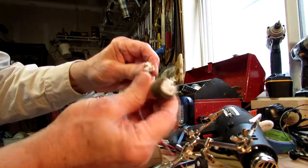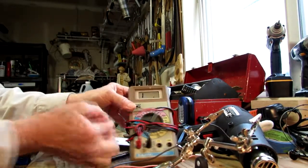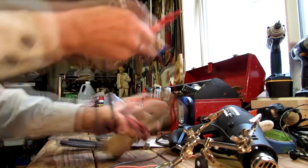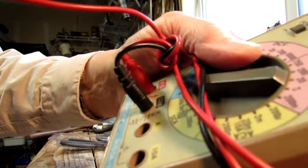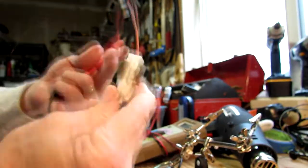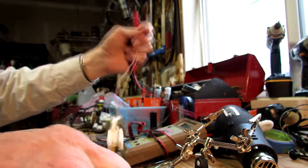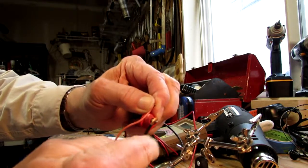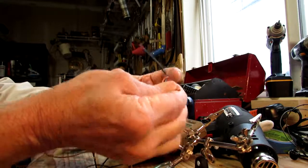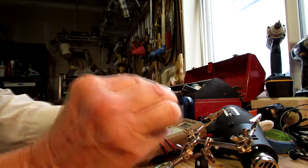What you have to do now is stick this back together. Get yourself a meter that can check continuity or show some kind of complete circuit. This one beeps. Okay, so you take the connector, you take one of the wires, it's all connected. This will be your yellow connector. When you take one of these and put it on the meter, you see if it's the same connection. It is. It's beeping. So the black and this go together. Ouch. Okay, they go together.